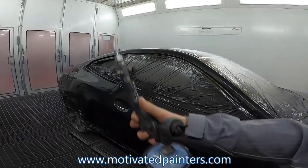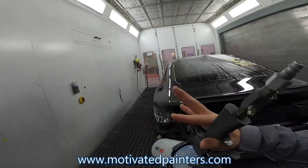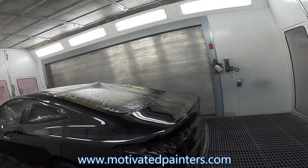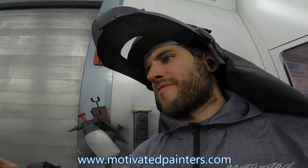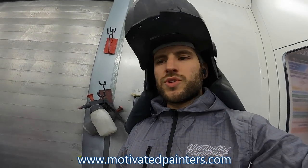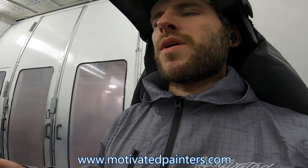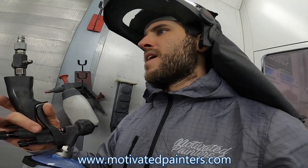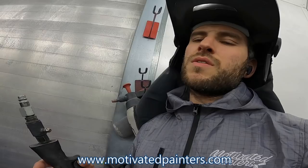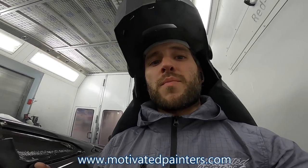A huge shout out to Enrique. He doesn't work for PPG, I promise. He told me about a painter that mixed 530 with 550 and it worked amazing. I'm not telling you to do this. This is not advice. But that's what I did. 530, 550, half and half. ECR's 5075 and then ECR 85 reducer. Man, I'm getting, I think, some of the best finishing paint jobs I've had in a really long time. So I really love it. So shout out to that painter.